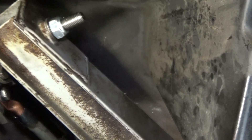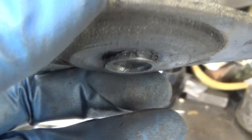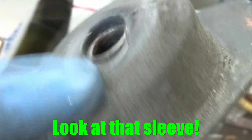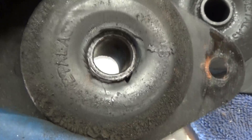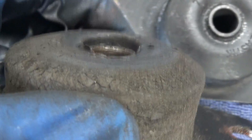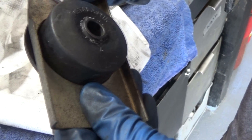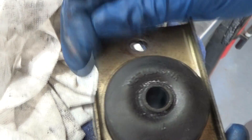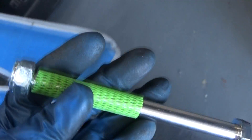There's the new Inconel bolt installed — we'll go ahead and repeat the process for the passenger side. We just took the other bushing off. This one's in a little better shape but you can tell it's still starting to show some signs of deformation. You can see that the inner sleeve is really starting to move around inside there versus the new bushing. One thing we noticed is that on the passenger side the bushing plate is kind of notched or trimmed down, probably for fitment — we don't know if that's original from the factory or done afterwards. We'll take our other Inconel bolt and try to fit it in after we get the new bushing installed.